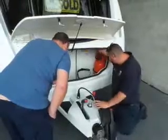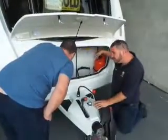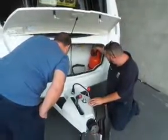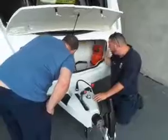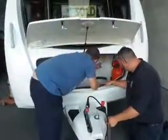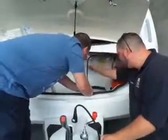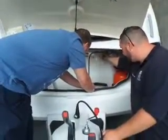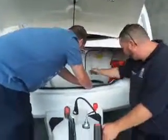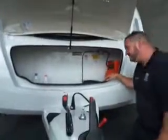Now, the gas regulator's on board on this, and this is a gas shut off valve here. Best way of switching your gas on and off is simply on the bottom, the cylinder itself. The gas shut off here is more for the gas testers and the testing of the gas system. So when it's in line with the pipe, that means it's open. When you're travelling, is it better to have that turned off? No, just leave it on. Just literally switch them off on your bottles. On and off and that's it.